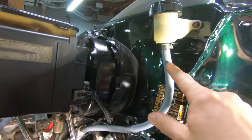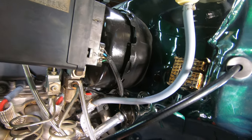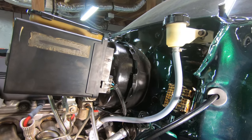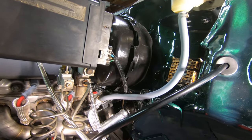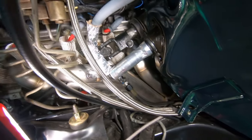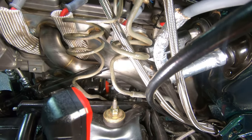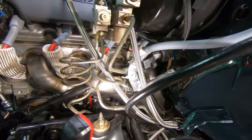I believe this was a Tilton — I'll have to double check on that. But this is a five-sixteenths ID piece of hose that's meant for brake line. My stock one was looking pretty rough — the outside was kind of looking almost scaly, kind of bubbling up. So I figured now's no better time to replace it. And I just put some bit of heat shielding on here. I think I'm going to have to wrap at least this one primary here — it's just kind of close to everything — with some header wrap. But that's where we're at here on the firewall side. We'll crawl underneath and show you what we've got going on under there.